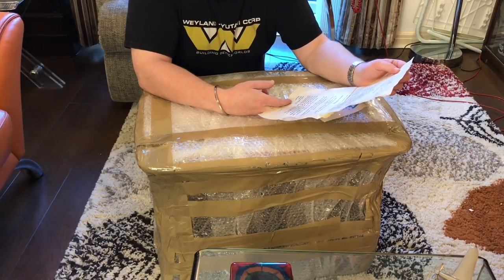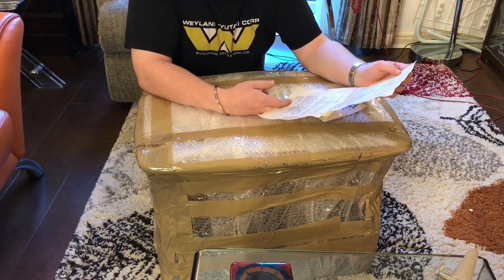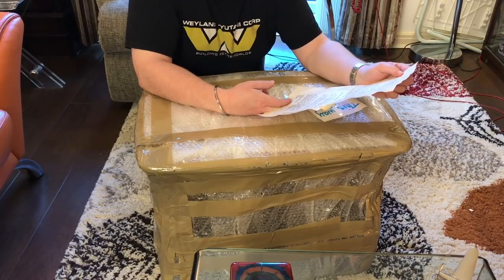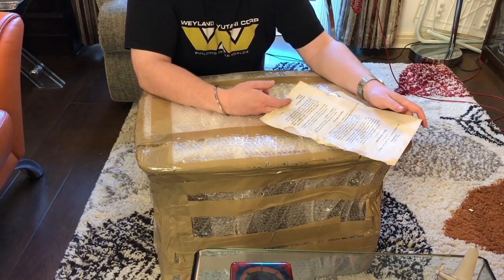Operating instructions. Remove the hose from inside the cabinet and screw onto the suction inlet. Attach extension wands and cleaning tool required. Plug mains lead into a convenient socket and switch on motor. Close the lid of the cabinet and you are now ready to carry out normal cleaning operations. Access to the dust bag is beneath the detachable panel in the inner platform. Hygienic disposable paper dust bags are used and each is fitted with a transparent window so that you can see when the bag is full and requires replacing. When full, just throw away and fit a new bag with window uppermost. See diagram attached. BYLOC Electric Limited, Enfield, Middlesex, the 12th of March, 1961.